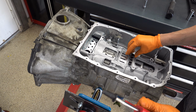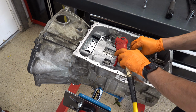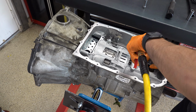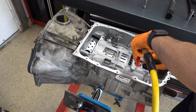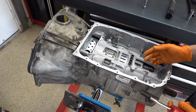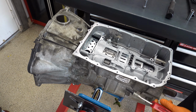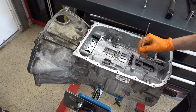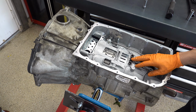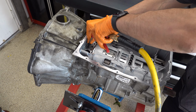And the little bit of air you're hearing is this nozzle. This is kind of hard plastic, it's not rubber, so it's not creating a perfect seal. Okay, so I'm happy with the way that sounded for each of these clutch packs. You could just use your finger or a pick just to double check, make sure that the pack is free. In other words, it's not bound up. So again, 50 thousandths clearance for each of these, non-selective, so clearance is what it is. So 1-2-3-4.